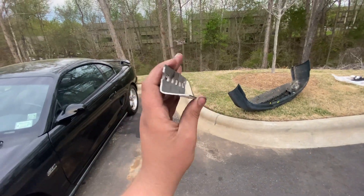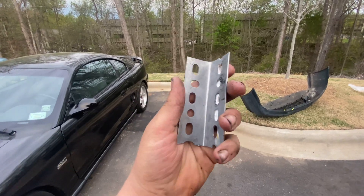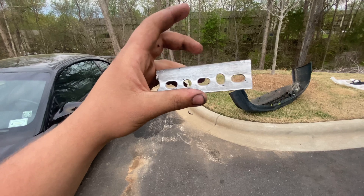This is what I'm going to be using for holding the intercooler. All we're going to do is cut it right down that V right there, use the pre-drilled holes to hold it in, figure out which hole is best, chop it from there, and then weld it on.